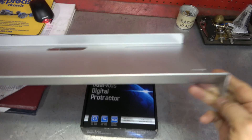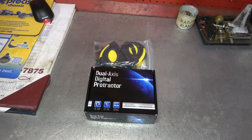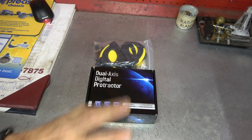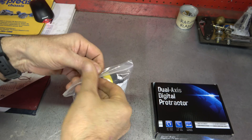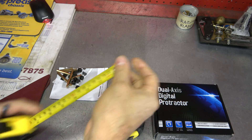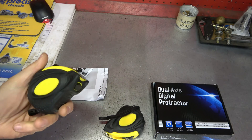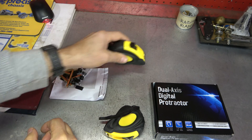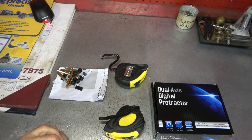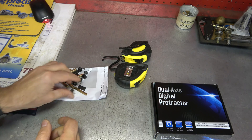Let me show you these panels. You can see they're cast aluminum and they're fairly thick, but they sit upright by themselves — you don't have to have them against anything. This alignment kit is not going to take up much room in your garage, much like the tire changer and balancer. The very old-fashioned way of doing an alignment at home involves using tape measures across the two tires to find the difference — maybe a sixteenth of an inch or how many millimeters out. You'd put tape down the driveway. It's pretty rudimentary; you'll get close, but not as good as a computer program like a Hunter alignment machine. But with this, having stationary plates and these offset pieces, we're actually going to be able to get right up to it.